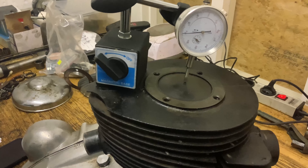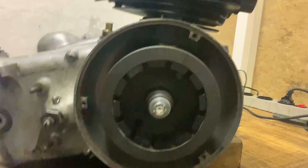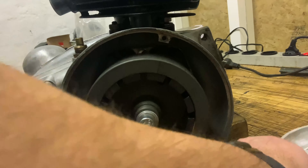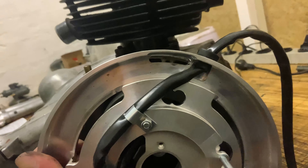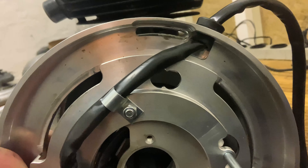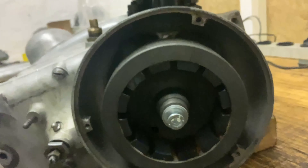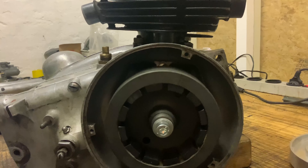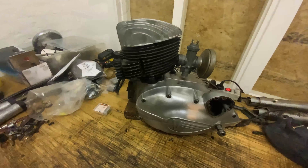That's the extreme — I could go three and a half millimeters or so. Looking down here, I think the indicator mark originally was this screw hole. Here you have the new marking, and if we take the new wheel there's a little hole to look through. If we're lucky we can mount it and — okay, it's hard to see, but I can see the line in there, and that's almost exactly where it should be. So around there is where I'll put it: one and a half millimeters before top dead center.